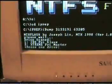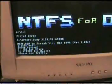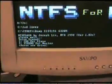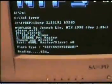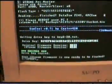This is the point where you need to switch the Blaster off. In Textbook's tutorial this is where you would switch the 360 off, but as we're not using the 360 to power the DVD drive, we switch off the Blaster. Coming back to the screen, we can now select number 2, our DVD drive, and count: one, two, three, four seconds, then switch it back on. For me, four seconds works — you may need a bit of trial and error to see what works for you.